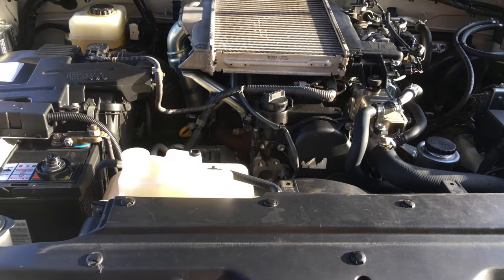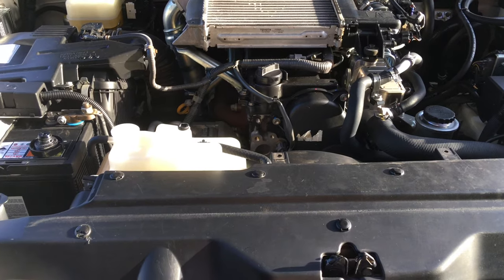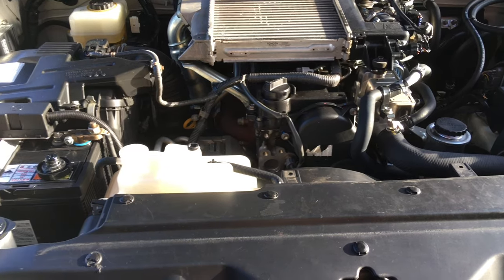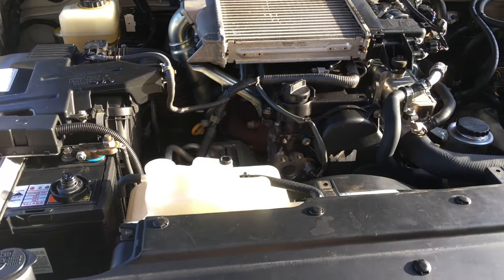You don't have to do it up super tight - it's an O-ring sealing it when you put it back in. Maximum information, guys. You take it right out - don't lose it. Have a look at it, you'll see the O-ring. Once the O-ring goes into the tube, that's what seals it and I've never seen one leak. Just keep it clean and put it back in. If you take it right out, coolant will come out faster and spew out backwards.